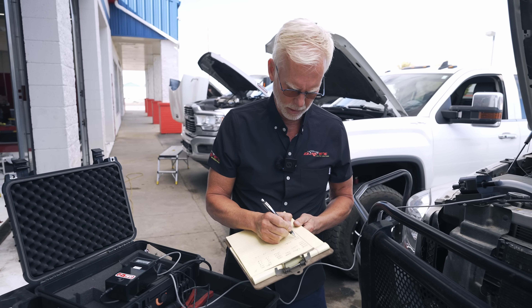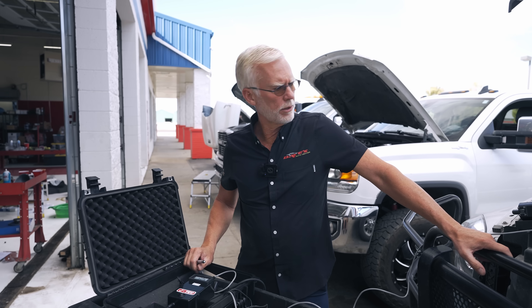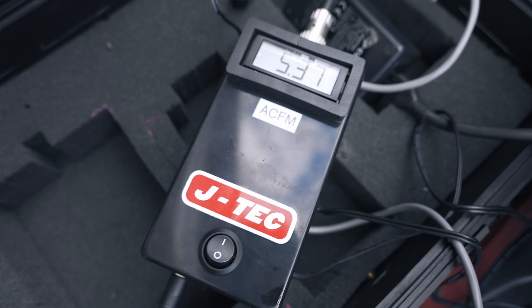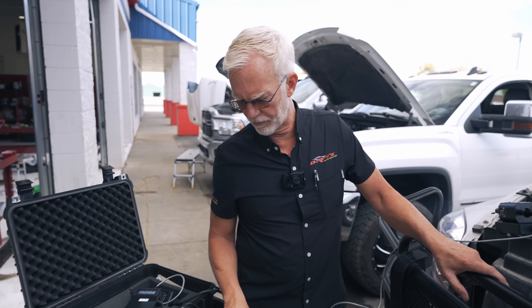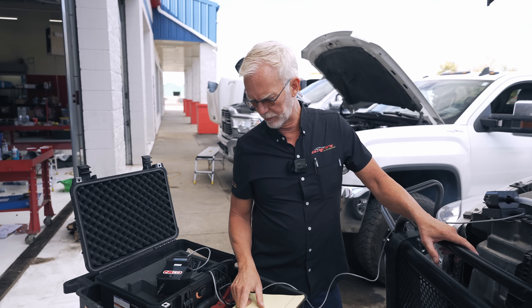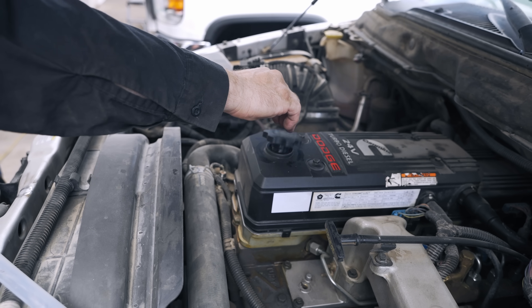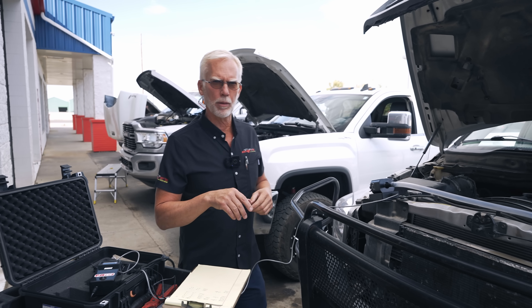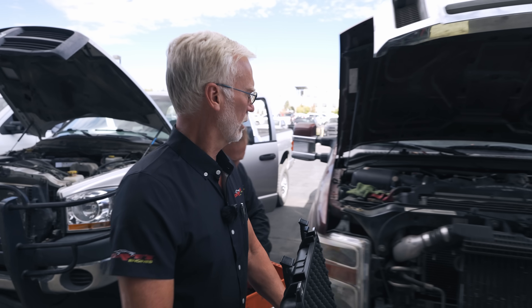2600 RPM. Let's see what we got — whoa, you can tell that ain't gonna be good. 5.3, 5.5. Take it up to 1500. So this one's got 235,000 miles and at idle and at 1500 it's running about five and a half. It seems like the ones that pop are above — when we get above 4.0 — that flutter test seems to be a pretty good indication you got excessive crankcase pressure. I love info — this is how you learn stuff. Got to gather the data.